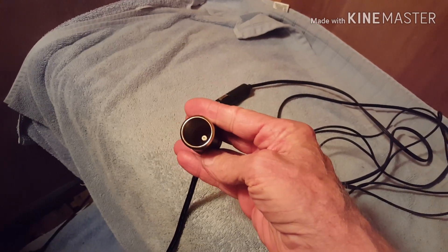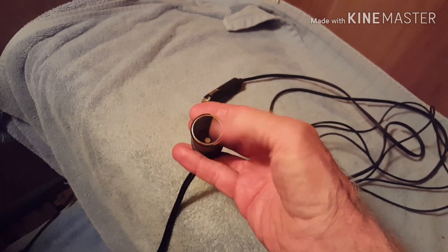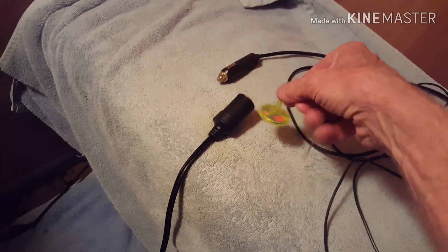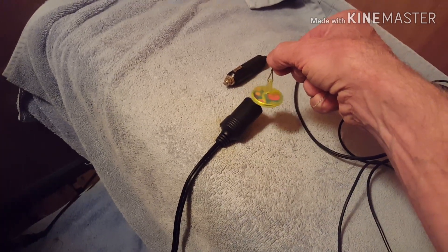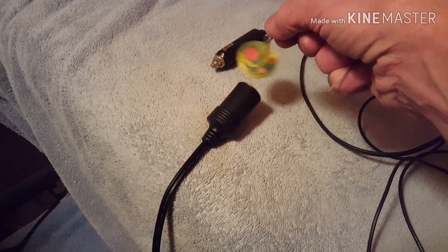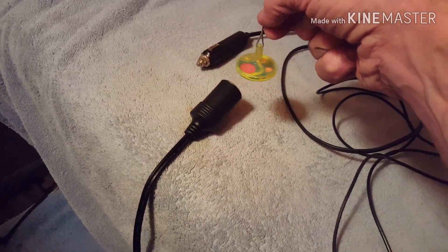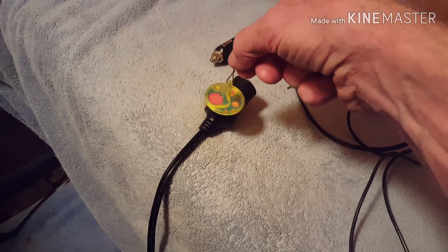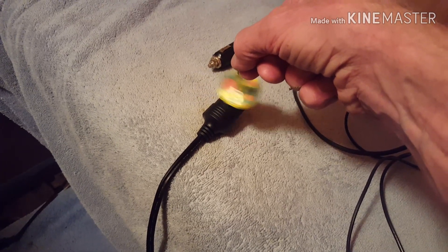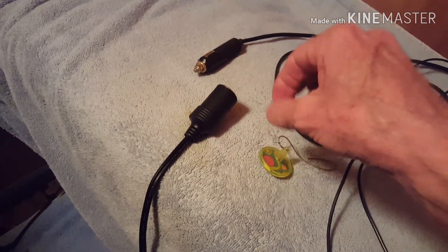For outlets, cigarette lighters and similar sockets, if you look down in there that little button at the very bottom is the positive, and the ring outside is negative. So I get a negative reading here, which doesn't tell me anything — because it's the positive that goes bad when the fuse breaks. But if I go to where that button is, I get a positive reading.